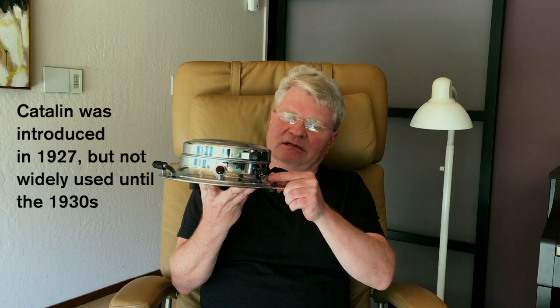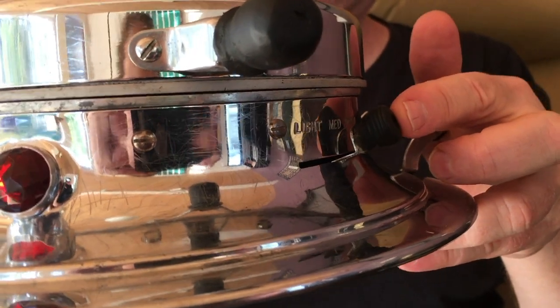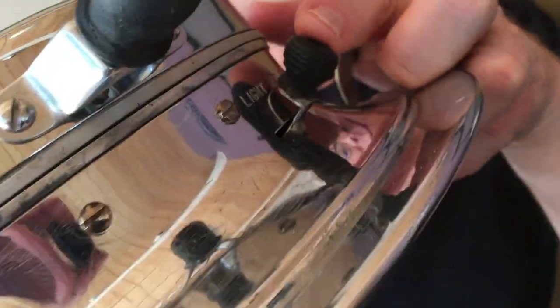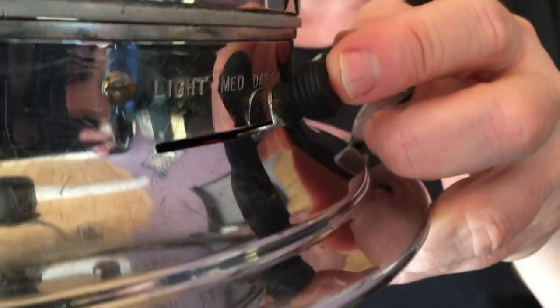So George is probably right. This sort of fell apart when I was aggressively cleaning it — some of the plastic pieces fell out of the bottom. It's still on there really good because the screw post goes all the way through, but I wound up building up the plastic again with baking soda and crazy glue and painting it, and that worked really well. If you've never seen that done, look on YouTube for baking soda and crazy glue, and you'll see lots of people fixing plastic that way.